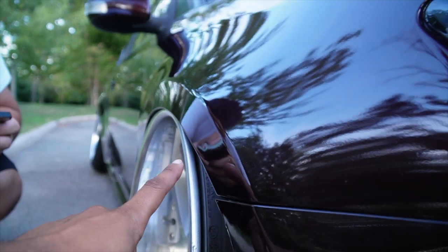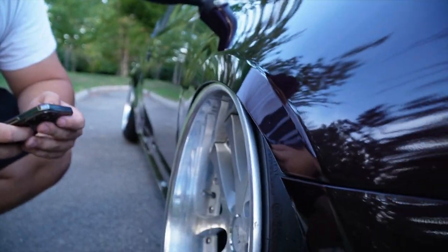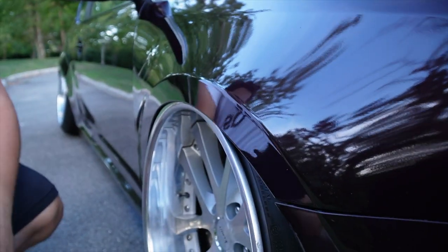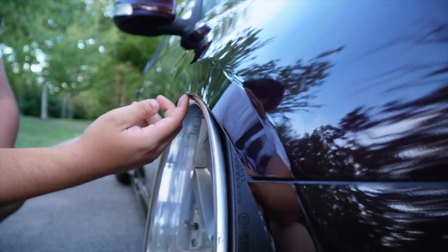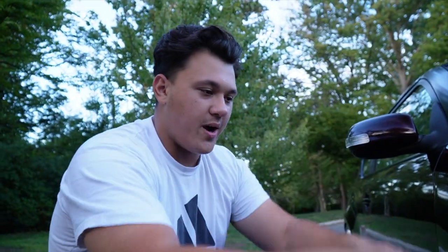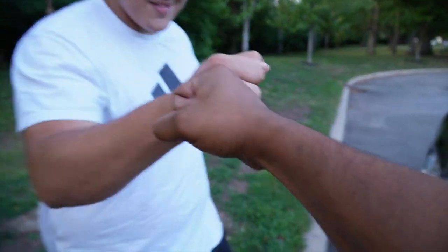The craziest thing is that he just aired this thing up, stuck some newspaper and cardboard, and aired it out — and these fenders aren't bacon'd. People bacon their fenders when they actually use a fender roller. We heated it up one time and the paint started to bubble, so we stopped. We just dropped it and while it was sitting low we pulled the fender out. It took like 10 or 15 minutes each fender, and the fenders came out beautiful.